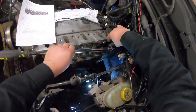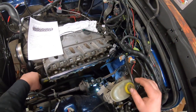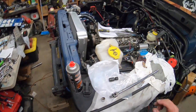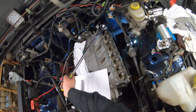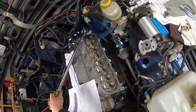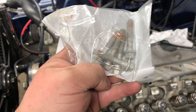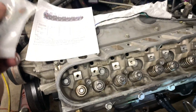The two short ones I'll only do to 50 degrees. I'm going to rearrange and try to do this one from the front as well. I should be able to see 50 on the dial. I'm at about 40 — a smidgen more — there, 50. Last ones to do: put these in, torque them down to 22 foot-pounds, and this head is torqued.